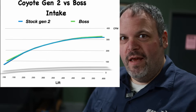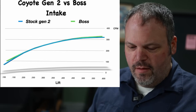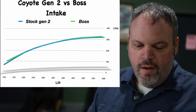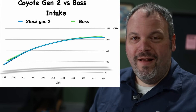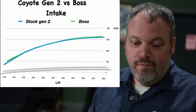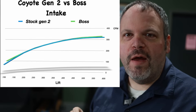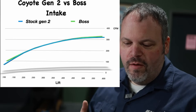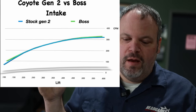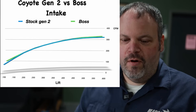All right guys, let's do the results — are you ready for this? On the intake side, rather than showing numbers on screen, I'll walk you through: the Gen 2 is losing at 100 lift by 19 CFM — the Boss is winning. By 300 lift they're even, and then the Gen 2 comes on and takes off by about 3 CFM at 350 lift. At 400 lift they're the same; at 450 it's a dead heat. Then the Boss wins by 3, 4, and 7 CFM all the way up to peak. I flowed this up to 600 lift, although you're never going to buy a 600-lift cam for this thing.